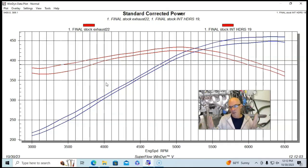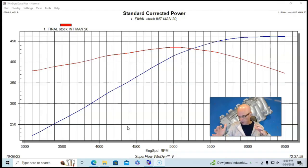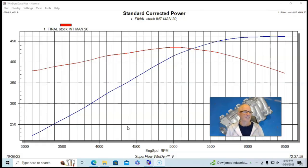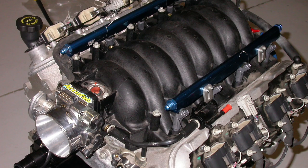Now let's look at what happens when we upgrade the intake manifold on the LS1. For those who don't know, the early LS1 has actually the second worst-flowing factory intake manifold GM ever made for the LS engine family — only the front-wheel-drive LS4 manifold is worse. Not long after, GM introduced the LS6 manifold and eventually made it a running change on all later LS1s, and it definitely makes more power.